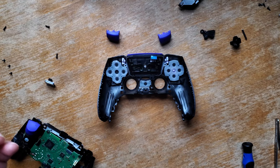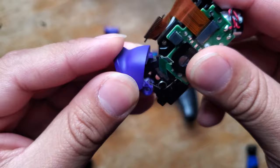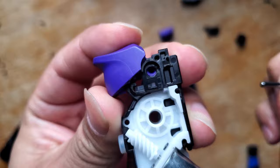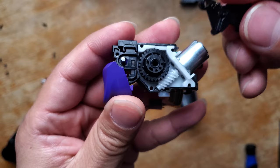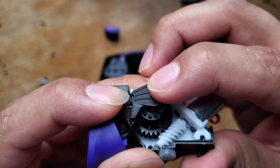Let's put the L2 button in — this little end right here, put it in there. From there this part can go in. Put your rod back in and line the hole with the button, then push down and test it out. From there you're going to put your little wheel back. There are three little circles here — make sure they're facing like this towards you, so when you put this piece back, it's going to be at the end right here. It should look something like this.